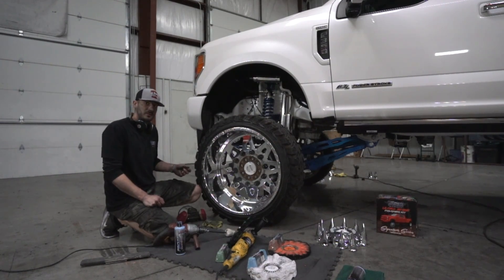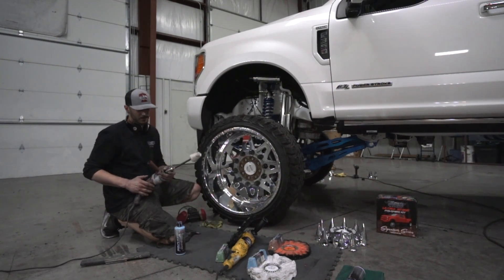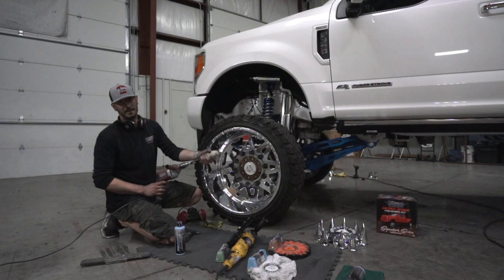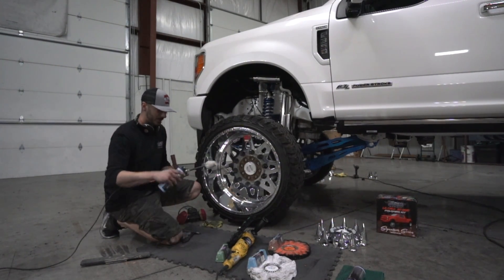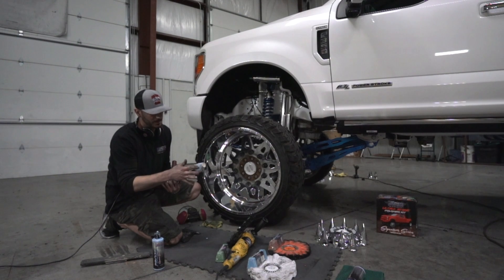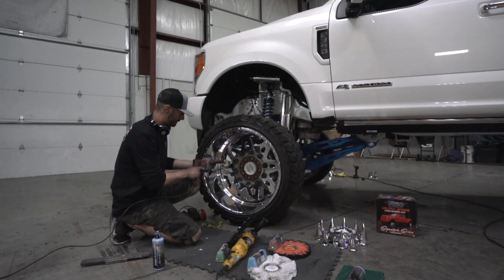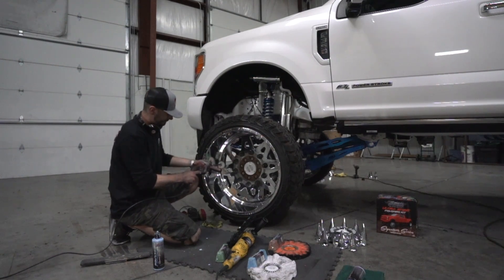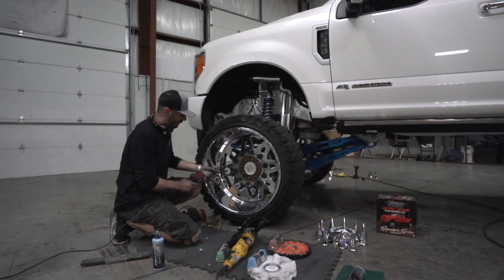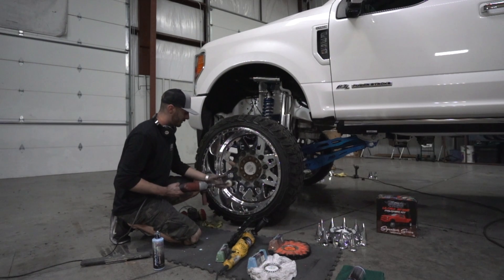Probably the most frequently asked question we get is how do you polish between all the holes and spokes with all these different designs. One of our favorites is the tapered bit — the two-inch comes with a shank that spins freely, so when you turn your drill on, you just hold it right here. All we need to do is add a little bit of the Pro 25 which comes with the kit — just put a tad bit, rub it in with your finger a little bit. You don't need much. Put it up in between your holes and work it in all the way around — tapered bit gets to your corners, use the end. When you get to the back part, use the bigger, fatter part. You should be able to get most of these holes.